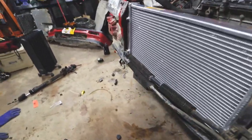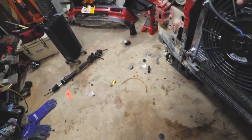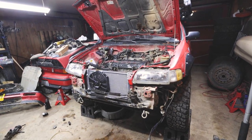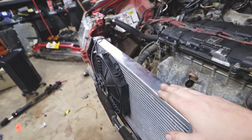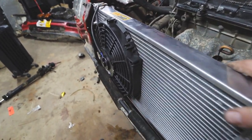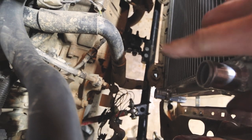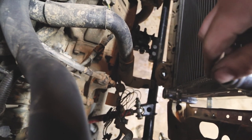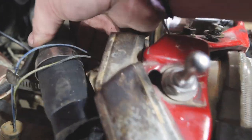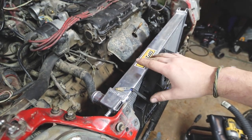With these slim fans and the tucked radiator, it's a life changer. You have the power steering coolers here in front, which I bent up a little so I could clear the fan. This radiator is from a VW Scirocco — a lot of guys use these for tuck radiators. There are just two inch-and-a-half outlets, one lower and one upper. The lower radiator hose from the D-series will go right there perfectly. The upper you can fish in there if you wanted to.